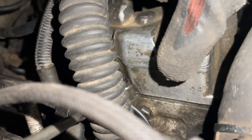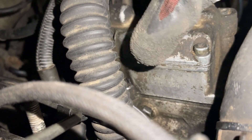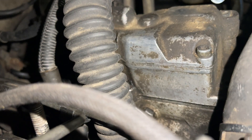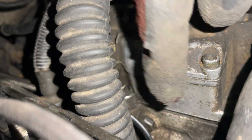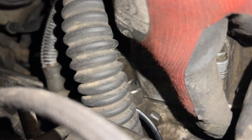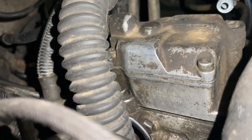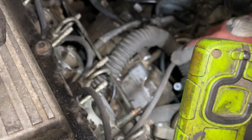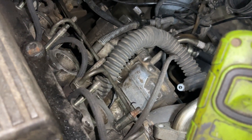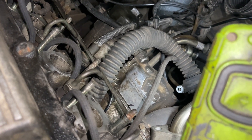The pump can slightly move, and apparently even slight movement puts the revs and fueling out, so it needs to go back exactly where it was. I cleaned this all up with brake cleaner so it's nice and clean and I can mark it in a couple of places. I've marked it as best I can — there is a wobble at the top but you can see the line on the top and the bottom.